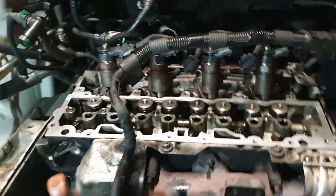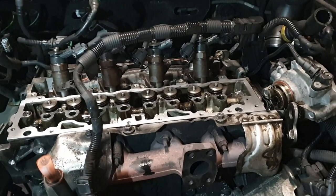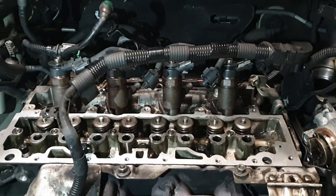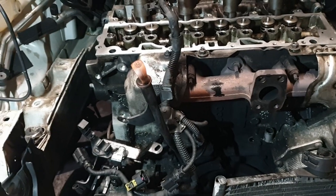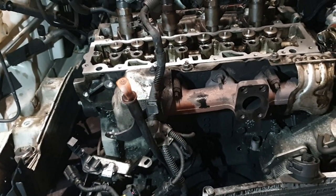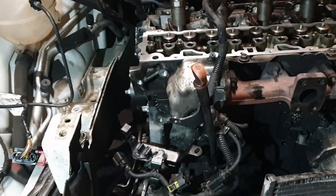So yeah, next step, get some instant gasket on, get that next section on, then lube everything up, cam can go in, then that top cam follower. First I'm going to rotate the engine and get the bottom on the timing mark, just to make sure we haven't got any pistons right at the top, but in case I've got to rotate it around to get it there.